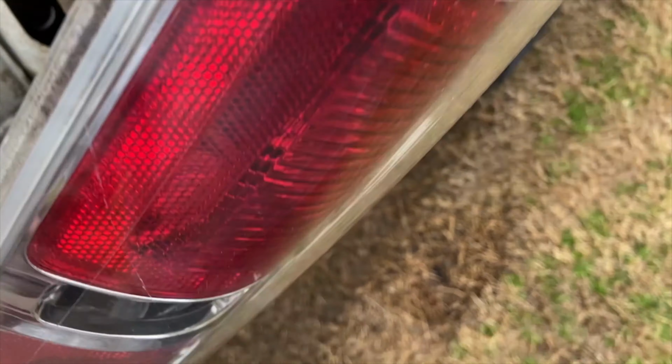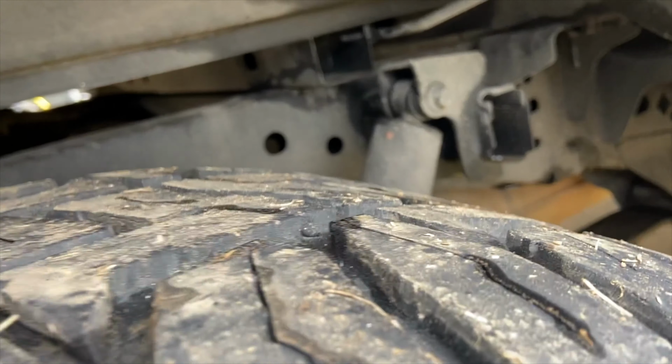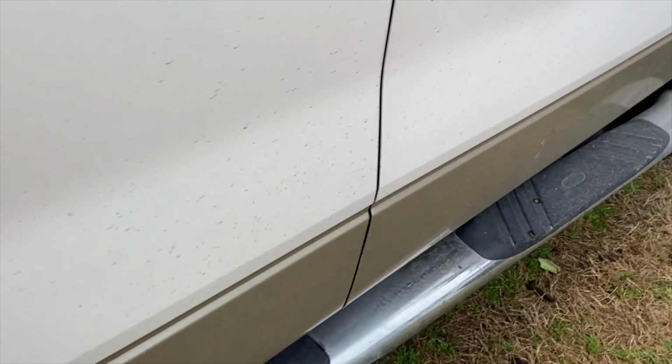So I got my first access hole, and I think it's going to come all the way down the bottom. I've got to figure out the best way to run this wiring, following some other lines, with Velcro, where it's not any abrasion against anything, and I will have the wiring in protective flex tubing. So that's going to be the hardest part of the job, running the wire all the way back there, all the way up, and coming in from somewhere under here. I could probably pull that little flap back and come into my battery, which is right here.